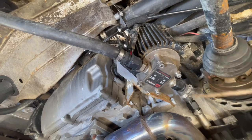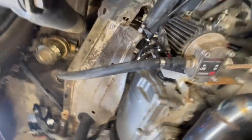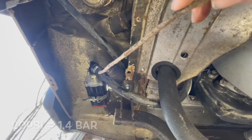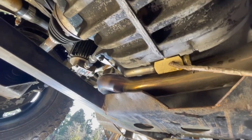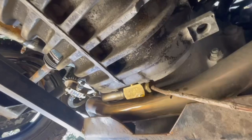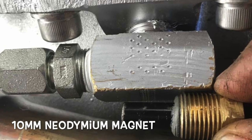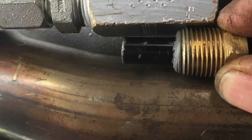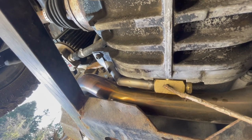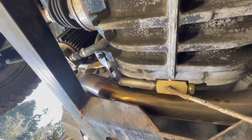Here's the pump — it's a Weddell pump, it pumps two gallons per minute, and going through the system it seems to generate about 20 psi oil pressure, mostly caused by back pressure from the filtration system. Here's the T where the oil comes out of the gearbox — the suction out of the gearbox — and right there is a big magnet. All of the oil comes out of the gearbox through this annular space around the magnet — a neodymium, really strong magnet.